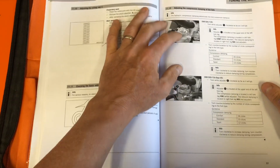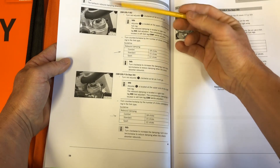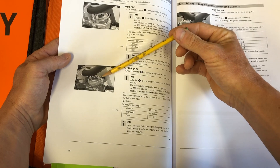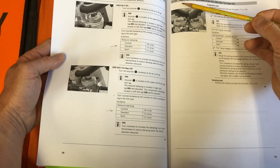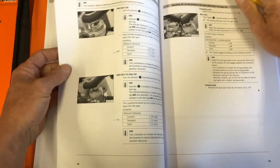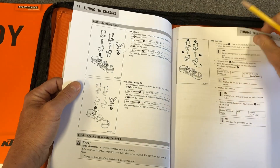The first section of suspension setup is for setting up the clickers and the rear end; the second section is for tuning the front end. They give you clicker settings for the forks — rebound and compression are on each side. One fork leg is white, one is red. It'll also walk you through the preload, which is the outer ring on the right-hand side. This stuff is not secret — it's just in the book, you've got to read it.